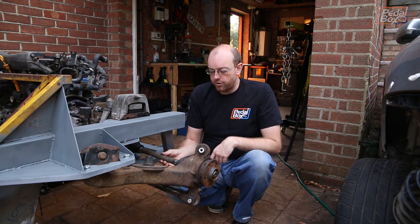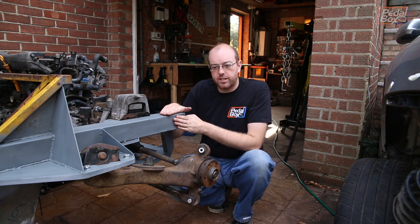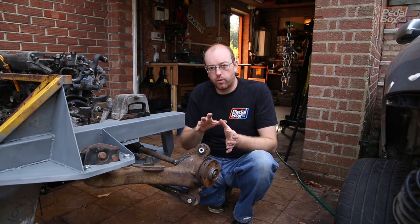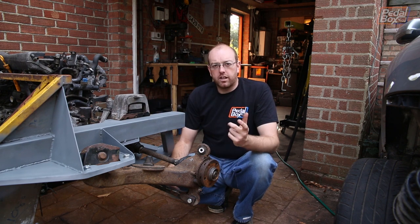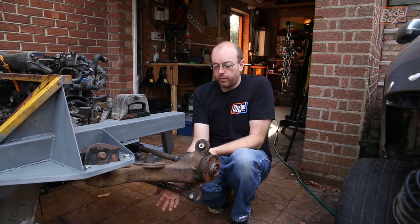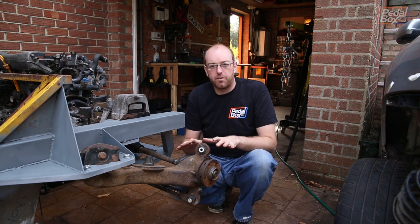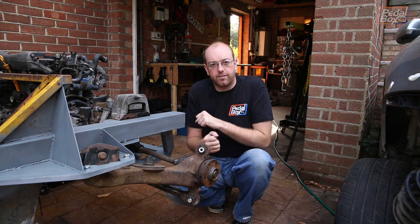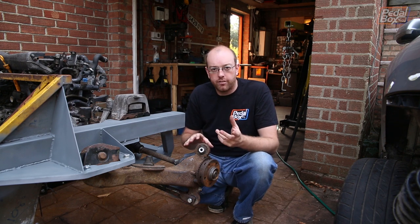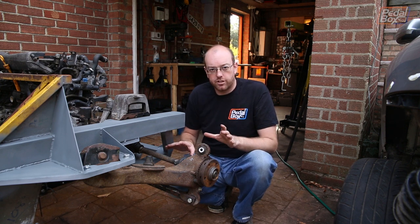All of our hub angles have been set with the driveshaft being level, so we need to make a jig that sits across the top of the chassis legs and holds the hubs with the driveshaft angle flat. Now that we have a fixed lower arm, we have something that holds it in 3D space, which we didn't have before — everything was moving around with no fixed point of reference.